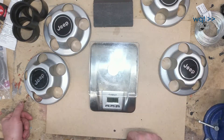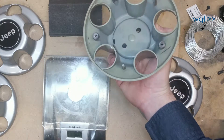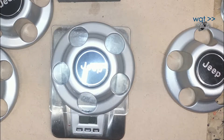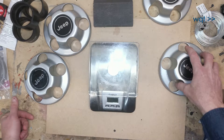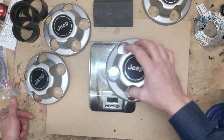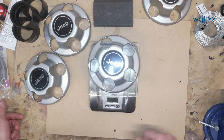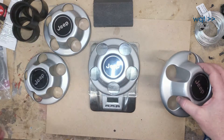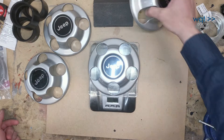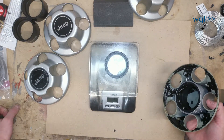Turning on the scales. Taring it out just to make sure it's at zero. Here is one of the unmodified wheel centers. I'm getting 3.8 ounces or 108 grams. So now let's pull that back off, make sure we return to zero. Here's our modified one - how much weight did we add? We are now at 6.52 ounces or 185 grams. So 108 grams versus 184 grams - we didn't even double the mass of it, which is nice, and a good chunk of that's coming from this little guy right here which adds 45 grams all on its own.